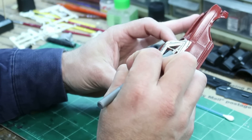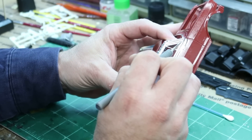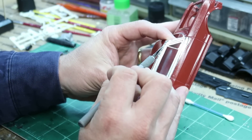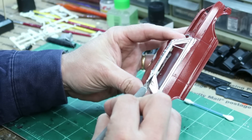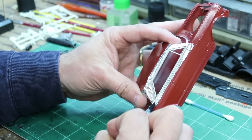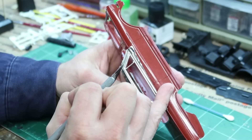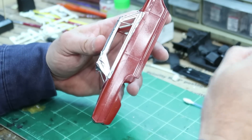I'm going to cut this thing out and probably make an idiot of myself as I usually do. Okay, bottom edge first — let me make sure how much I'm cutting out. Starting right here and going — I don't know if you can see this or not. Just like so, then I'll come up here on the top rail. Pressing hard enough to cut the foil but not hard enough to damage the paint. If your knife accidentally gets off track, you don't want that — you want to be super careful how hard you press because it will cut right through the paint and you'll have damage. Sometimes it is the hardest to see these edges.